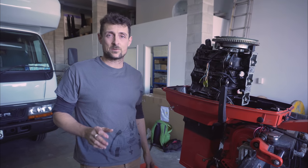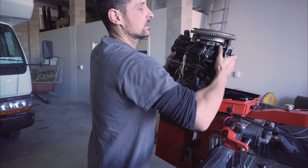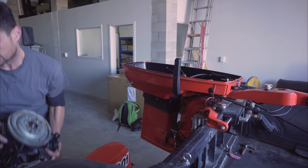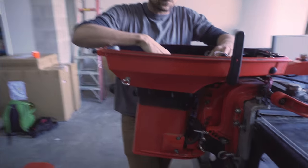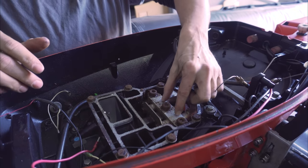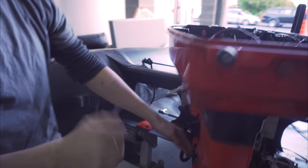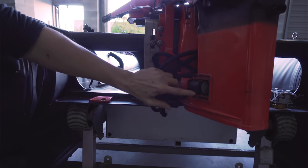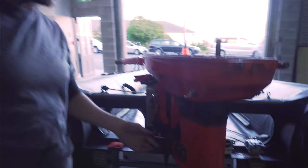The third thing you want to do in preparation for nationals is swap out the engine brackets. They come with rubber-mounted brackets from factory. Looking underneath here is the top bracket — we swap these out for a solid bracket on top. This one's made of alloy, but the lower bracket, which we also swap out, is made of a hardened plastic. These are also available from Camsmarine.